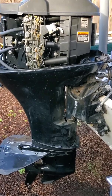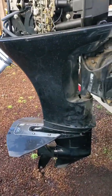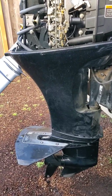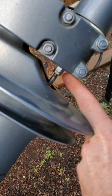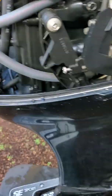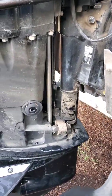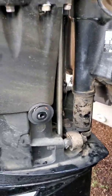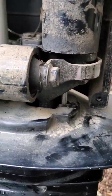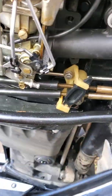I got the cowl off the engine. When it comes to disconnecting the shift rod, this rod appears to be one piece all the way top to bottom. Usually there are two nuts on a lot of these shifting rods, but this particular Mercury doesn't have that — that's what threw me for a loop. I took the plastic cover off to show everybody that there is zero access to the shifting rod underneath on this particular engine. There's no dual-nut system; the rod runs all the way up to the shifter at the top.